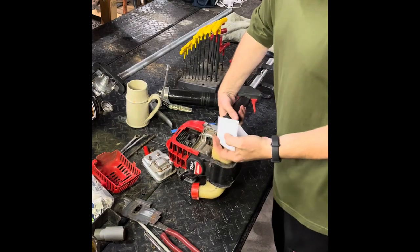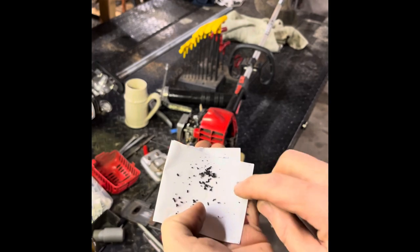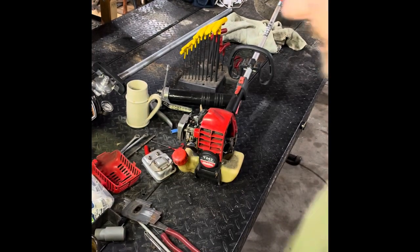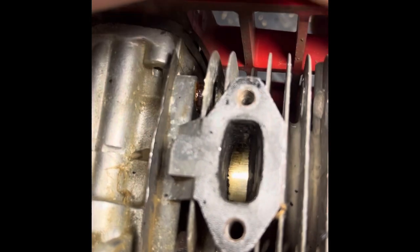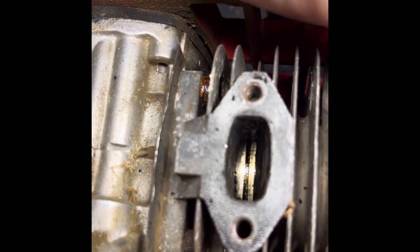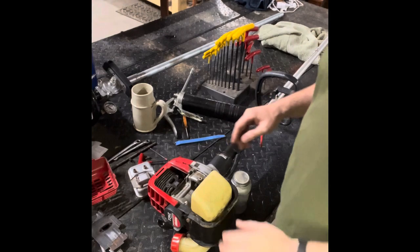I'll show you just how much came out of there. That stuff can come loose and score a cylinder. Also when that muffler is off, you can look at the piston as it goes by and look for scratches. When the cylinder is down, there are your rings — you can look into the cylinder walls. This thing is in good shape; I'm happy with that.